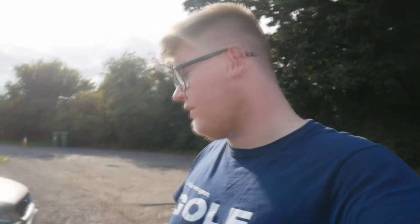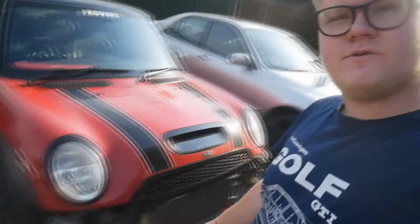Okay, so it's a bit later on in the evening now. Unfortunately the car still isn't fixed. The alternator that my friend David bought was the wrong one. It had 2 pins, whereas mine needs 3 pins. So I ordered one from Euros. It'll be here tomorrow, so we'll get that fitted as soon as it gets here. But for now, it's just going to be like this.